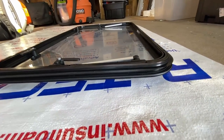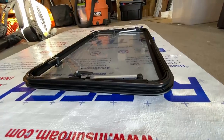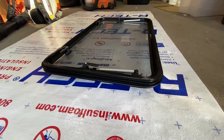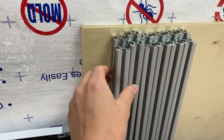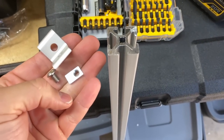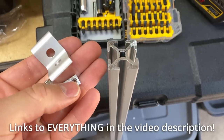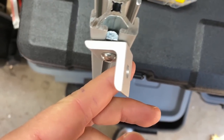For the next step we're going to build a frame that sits inside the window, clamped between the outer and inner frame. Arctic Tern windows are not engineered to fit on vans or sheet metal — to make them work you basically have to create at least a one-inch gap. They recommend using either wood or aluminum tubing. In our case we're using 80/20 extrusions. We just need to create a square frame out of these. This is 10-series 80/20 so it's one inch thick.